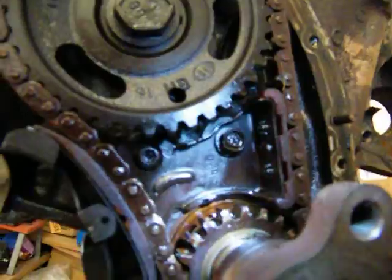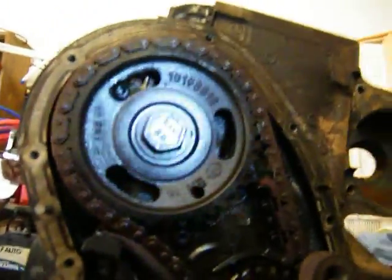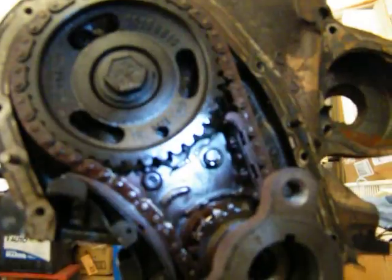So we're good there. So if I use that gear right there, then now I know how to set it, because I was looking a while ago. I didn't see a little dot. I'm used to dots. Just like that little dot right there. Can you see it? There you go. And then that is the lining mark there, and then that's the lining mark there.